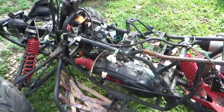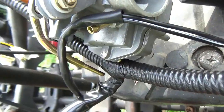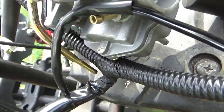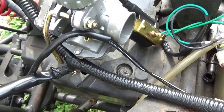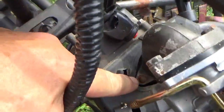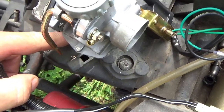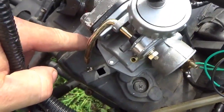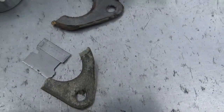Let's get started. If you guys recall, I just replaced the carburetor that's on there, and it's breathing through a hole I can't even get my index finger into. It already came with this manifold on it. Looks like I have plenty of space to mount a PZ27, so that won't be an issue. The cable might be a little short. I'm also going to check the gasket surface - if there's no gasket that would explain some of its running characteristics, since it's got a second vacuum leak. I fixed one but not that one. I took it apart and replaced the gasket, which was kind of difficult - you had to break a razor blade in half to make the gasket changes.